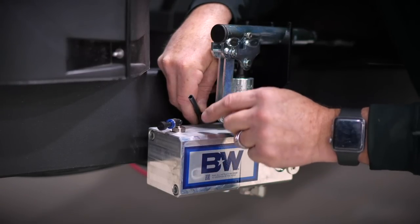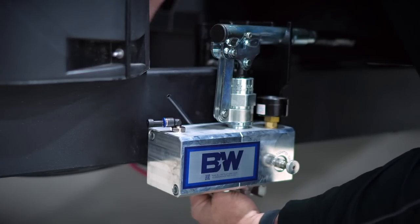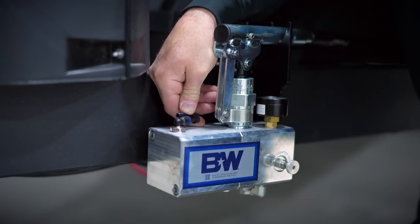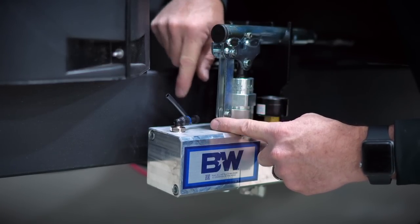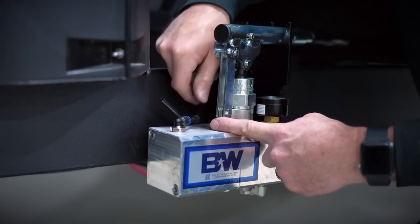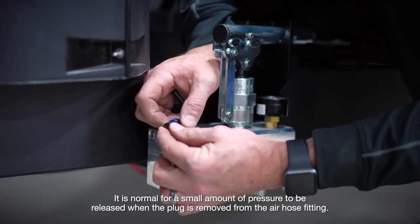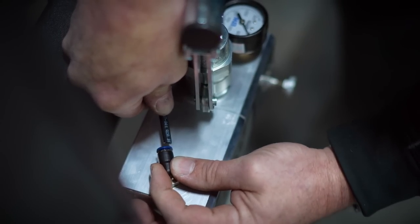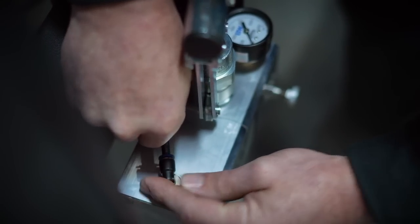The last step of the hydraulic portion of the installation is to attach the vent hose to the vent on top of the pump box. Bring the hose up from under the trailer between the trailer and the box. It's likely already cut to the right length from the factory, but if you have excess length, you can cut it — just leave some slack. If you do cut it, use a hose cutter or razor blade for a clean straight cut. Avoid wire cutters, as they can smash the end of the hose into a football shape and cause leaks. Remove the plug by pulling back on the blue collar, discard the plug, twist the fitting to line up with the hose, and firmly insert the hose into the blue collar until it's fully inserted and bottomed out. It will self-seal when you're ready to use the system.